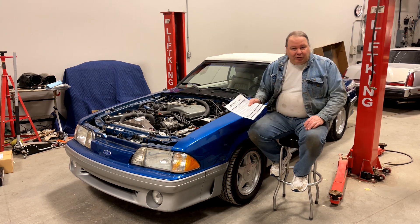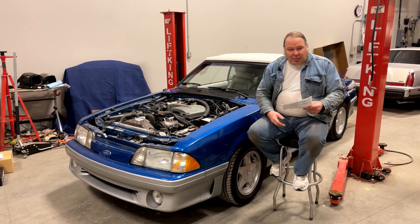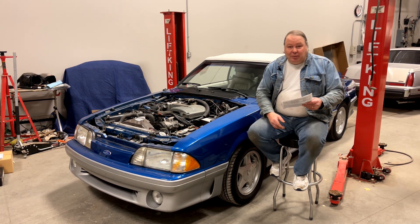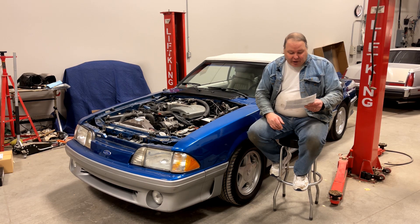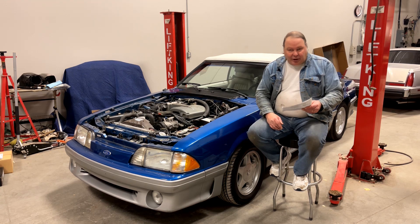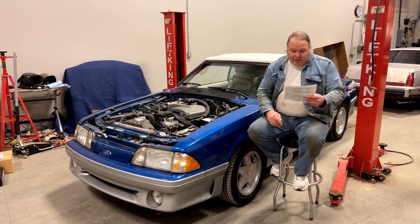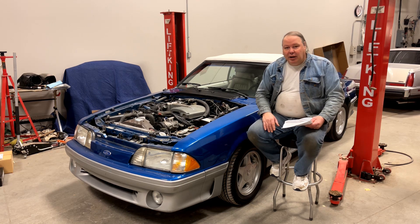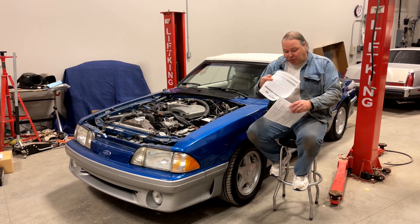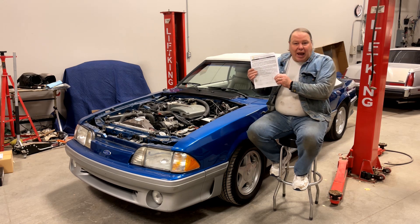When you bought the fuel pump, you probably got some instructions. I'm willing to bet a lot of you threw them away, but let me read from this Aeromotive 340 Stealth instruction kit — something you should really pay attention to: 'The factory fuel pump wiring may not be sufficient to handle the current draw of the Aeromotive 340 Stealth pump. To achieve the advertised flow at pressure, the use of an aftermarket wiring kit such as Aeromotive part number 16301, including 10 gauge wire and a direct alternator supply point, is required.' That's a real requirement. If you put a pump like this in one of these cars and use the factory wiring, you might only get as much as 60% of the advertised flow rate.